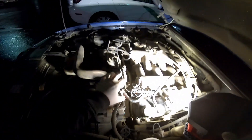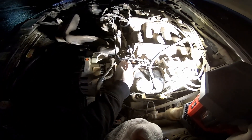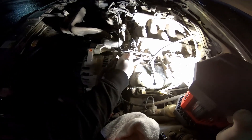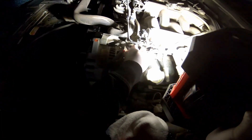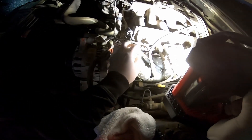Right here on the driver's side fuel rail is the fuel pressure sensor. I'm just going to squeeze this electrical connector and pull it off, and we're going to pull off this vacuum line as well. You also want to make sure that this vacuum line isn't cracked and leaking — that could give you an issue. These are on there pretty tight; don't want to crack it if it is good.